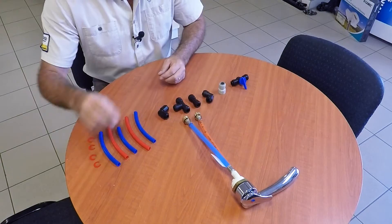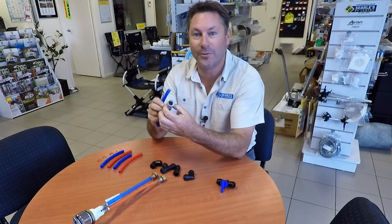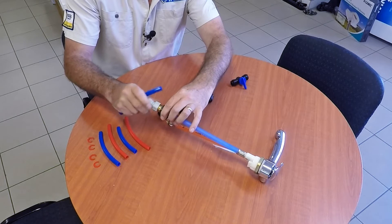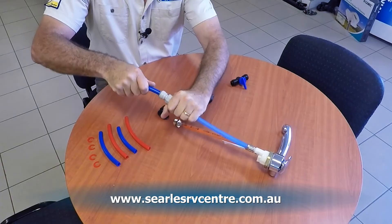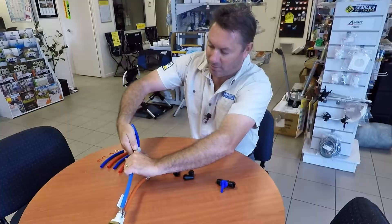So John Guest fittings with your caravan. I'll just show you this one here - this one is the most common one that is replaced when customers call up. If this screws into your hot water system, or this is a tap and it just screws onto the bottom of the tap like so, you've got your hose and it's pushed into it. Now what can happen is that it can be over-tightened and you will get a hairline crack around here and you'll get a leak. So they're normally used for hot water systems or on these taps.